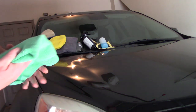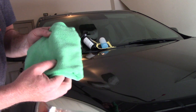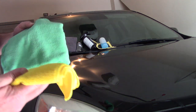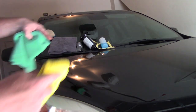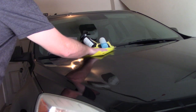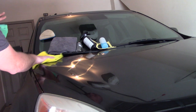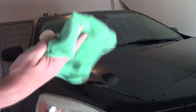I like low nap towels. Next week I'm going to have what I call my utility towel that will be perfect for coatings. A lot of guys like a short nap towel versus a long nap because silica or true ceramic coatings can be a little tacky when you apply them. I'm going to have two towels — one is my leveling towel. Now that the product has sat for two to four minutes, I take my leveling towel — this is not my buff off towel — and lightly go across the paint one more time to make sure I've applied the ceramic coating with even distribution. I'll lightly massage it in. This is where you'll see a lot of the rainbowing start to happen. I'll let it sit for about 30 seconds, then take a second towel — my buff off towel.